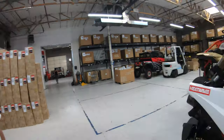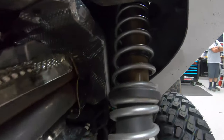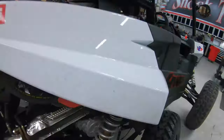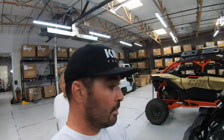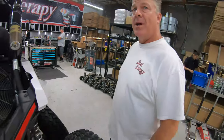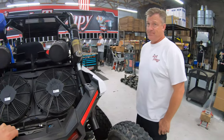They also did springs and valving. Absolutely — a cool spring kit on this setup, with spring rates dialed in for this car with its long travel suspension and extra accessories like radios, safety gear, cage, and all the items that add weight. The spring kit is perfect for that. The insides are perfectly tuned for the car — they modify valving for every car. They had a really good initial setup already documented for an RS1 because they've worked with a ton of them.